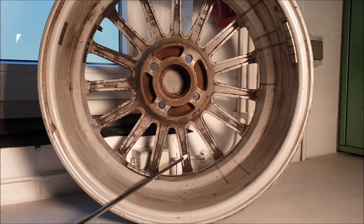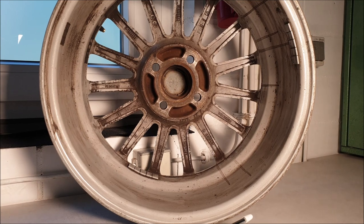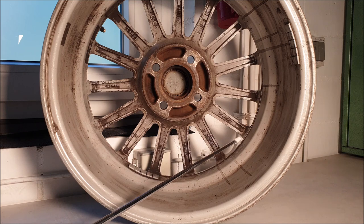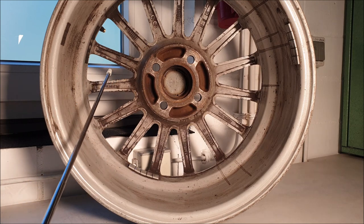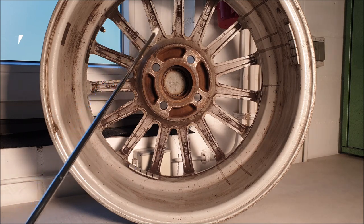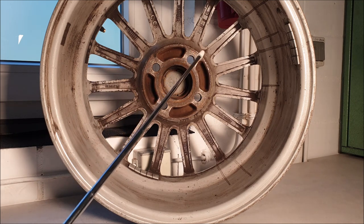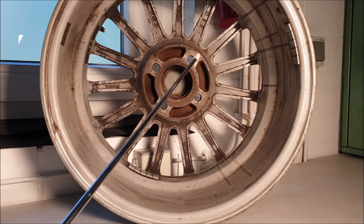You should also watch for the size of the wheel. In this case you can see we have 7 by 16 inch — 7 inch wide and 16 inch high. There are always a couple of other pieces of information inside such a wheel. For example, we have the producer Borbett, the model number of the wheel, where it was produced, and when it was produced. For Germany, Switzerland, and Austria it's also important that it's approved by the German, Austrian, or Swiss TÜV organization, so it's allowed to drive on the car and be entered into the car papers.